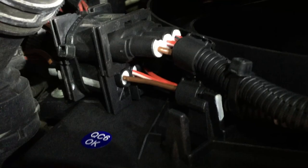The harness was a little too long so I just wire-tied the connectors — those slots kind of mated together right there. I stacked them on top of each other, put a wire tie around there, and it works pretty good. Just make sure you've got clearance with your harness and your fan blade so it doesn't rub.